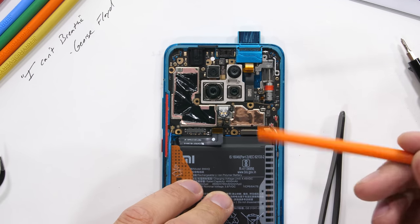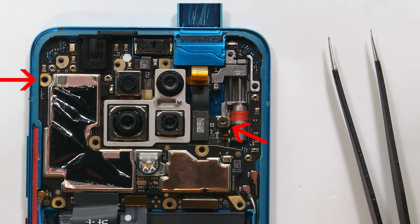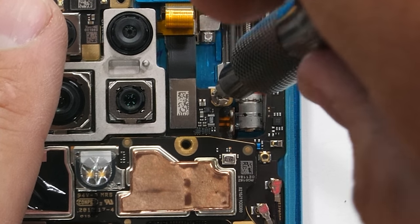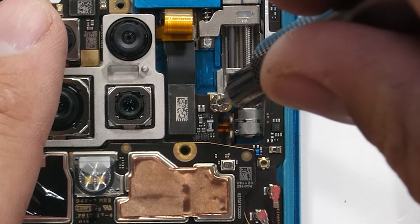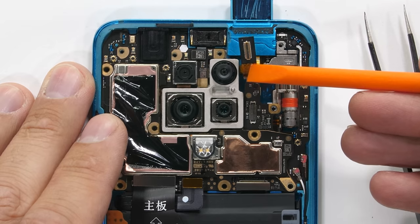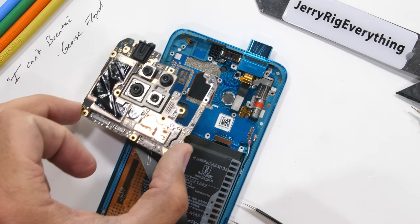The camera mechanism itself is mounted underneath the motherboard, so I'll pop off two more screws, one of which is a large silver standoff — one of those screws within a screw. I'll use a flat head screwdriver to twist this around at an angle. Once it's gone, I can pop off the large camera ribbon and the earpiece ribbon, and very carefully start maneuvering the motherboard out of the phone.